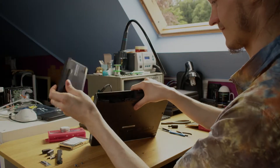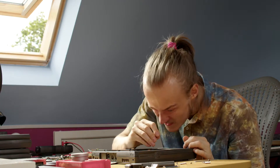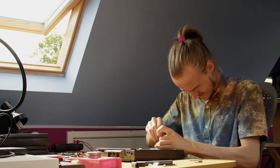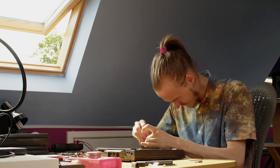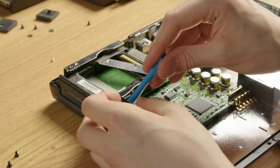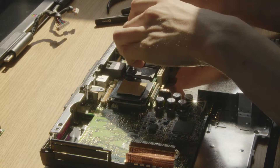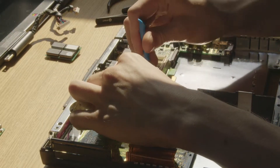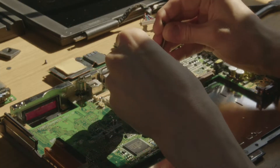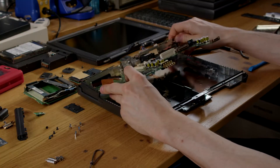Hard drive next. I forgot to take out the battery and the floppy drive. You have to get up quite close and personal to remove the trackpad cable. And then you just undo a load of screws on the underside — just lots and lots of screws. Then you can take the bottom off it and remove the buttons. Gently pry up the PCMCIA slots and pull them out. Then we remove the memory and remove the CPU. The CPU standoffs are very densely threaded, so it takes a long time to unscrew them with a pair of very small pliers. But then you can remove the logic board.